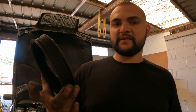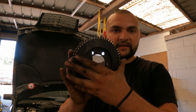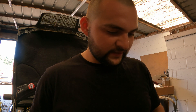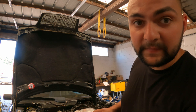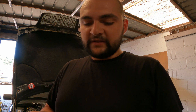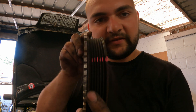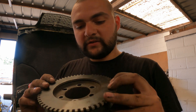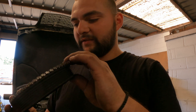I just removed the pulley that sits on the crank. This is our trigger wheel and this is our pulley — they need to mate together and become one piece. I'll need to grind a little bit down so I can weld it perfectly on the edge. I marked where the big dot was on the balance pulley. The plan is to weld on the inside so it doesn't interfere with the belt or the readings on the crank sensor. Let me clean it up and then we'll do a few welds — no need to be overkill.